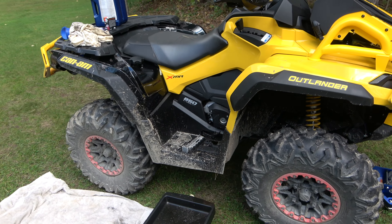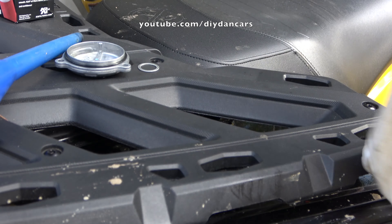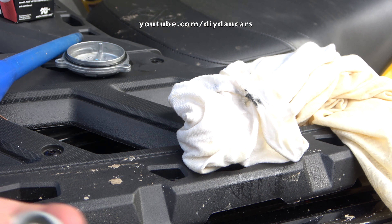Check to see if there are any metal shavings in there. Don't be alarmed if you do see a little bit — that's normal during a break-in procedure. I'm now ready to reinstall my drain plug. I'll clean it off. There's a little bit of metal shavings right there on the end of the magnet — I'm not alarmed by that; it's a brand new engine with only 9.3 hours on it, so pretty normal. Everything's all cleaned off, and I'll install my new crush washer.